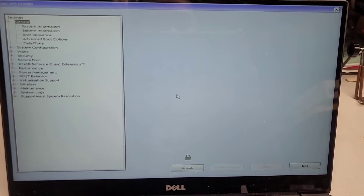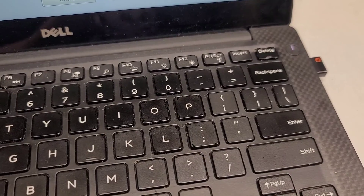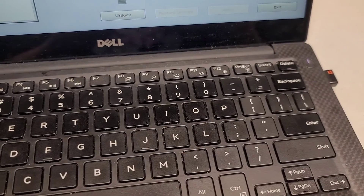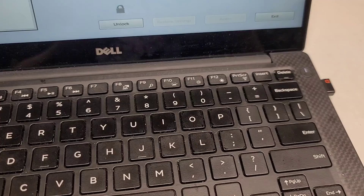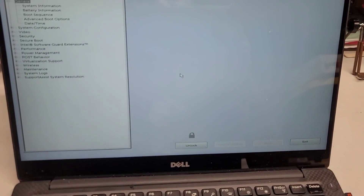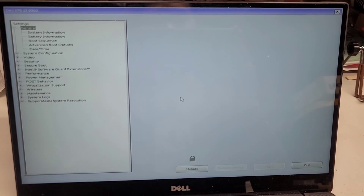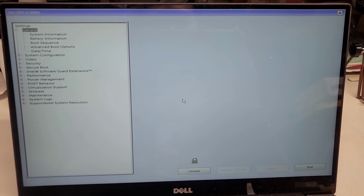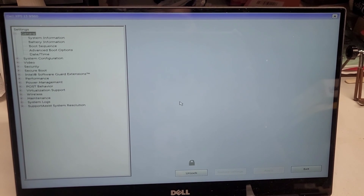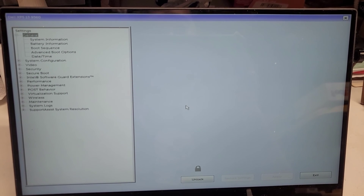The Dell did eventually come on. The power button light kept going off and on, and I had to turn it on a few times. It cycled on its own. Once it stopped turning on by itself, I turned it back on and just let it go, and it eventually came back on. Most likely it was detecting the BIOS was reset, so it was just power cycling itself. Hopefully this video helped — thanks for watching and I'll see you all in the next one.